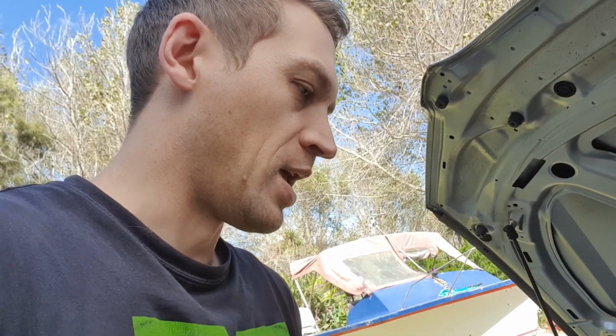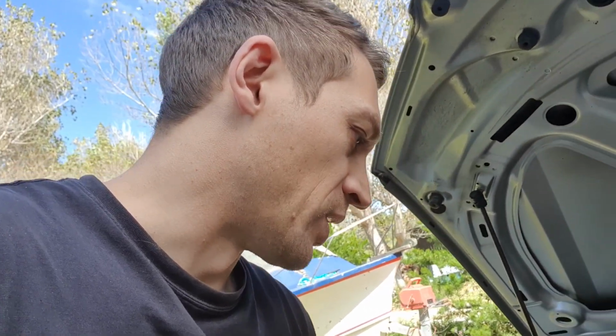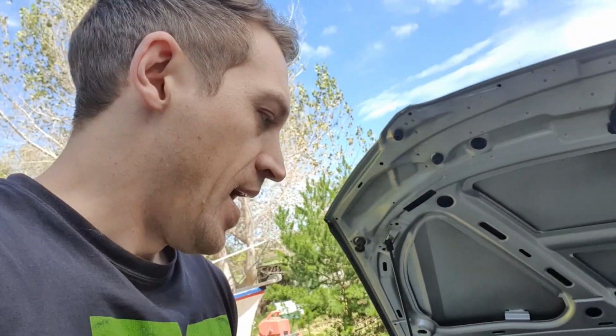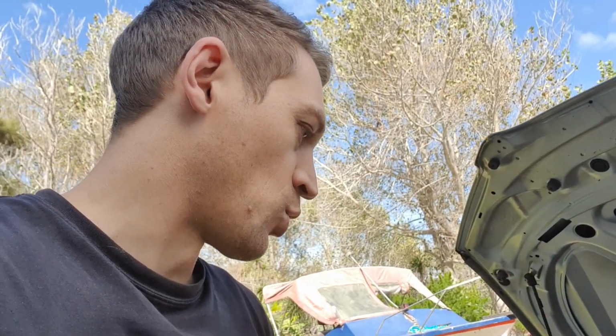I waited for it to run through its process. Usually after it had come off the cold start, it'd start doing it again. So I knew there was another valve under there. I tracked that hose down, and just by pinching it off, it automatically fixed the idling issues. So it's a nice easy way to diagnose quickly whether that's your problem.